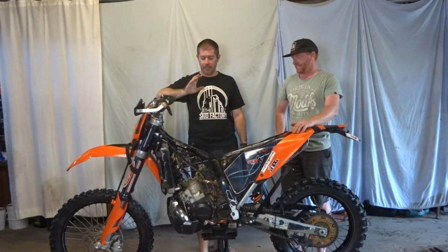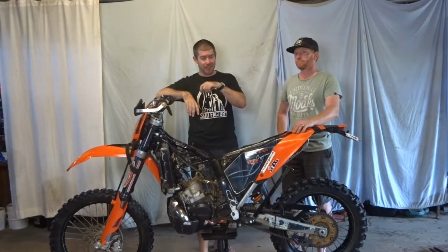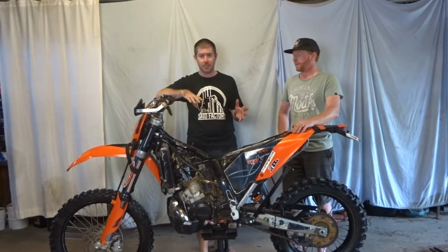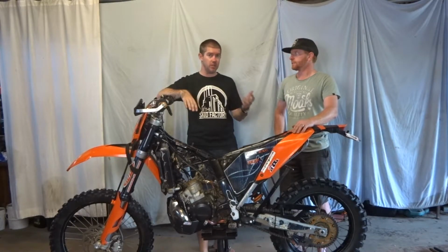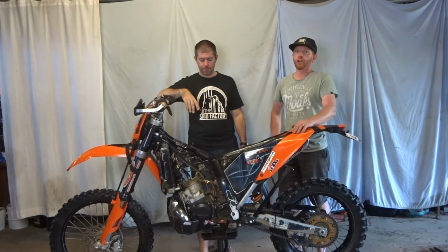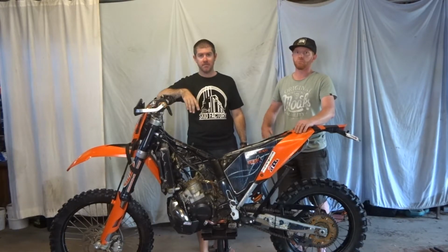Okay, so we've wet tested now, compression test, and 140 psi. If you roll it back, I think I said if it's going to be anything over 20 psi, you've got a bit of a problem going on, and that's basically 40 psi. And when you were kicking it, you feel a big difference. The first few kicks with the wet, you know that there's something wrong. It's a solid kick as opposed to the dry, which is not so solid.